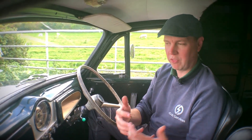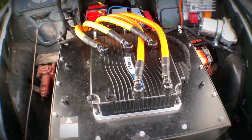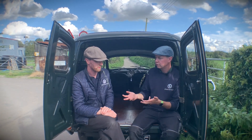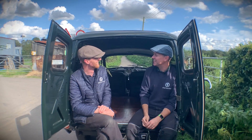So let's talk about the electric conversion. We've managed to keep all of that in the front where the engine used to be, to make sure the weight ratio is absolutely perfect. It's turned into something that we're calling our Universal E20 battery pack — that is actually a battery pack and a motor gearbox all in a combined unit, perfect for vehicles like this that were front engine but rear wheel drive. Tell me a bit more about what makes it universal.